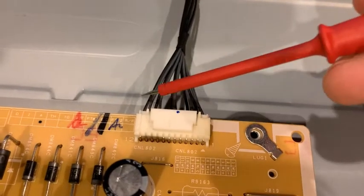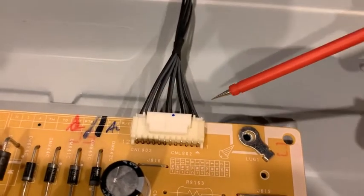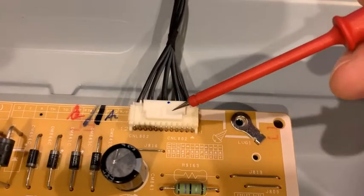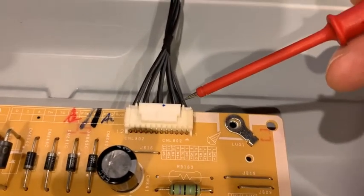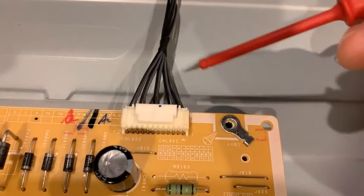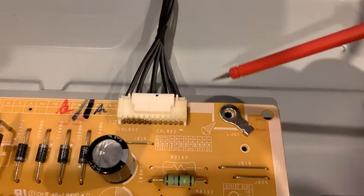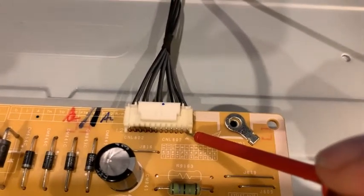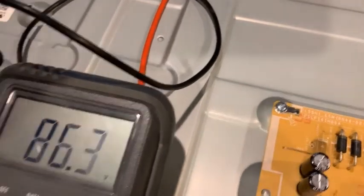You can see there are five pairs of wires — one black and one gray — so I have five LED strips. Typically they are connected in series, which means if one LED has gone bad then no backlight at all will be on.